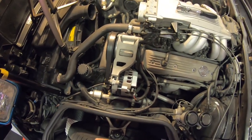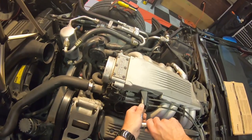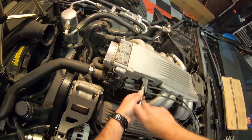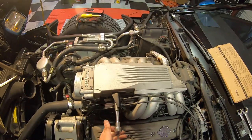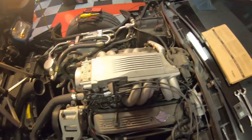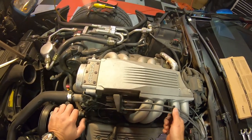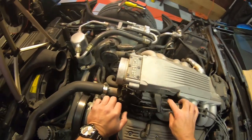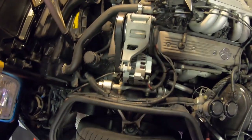And then there is a 10 millimeter socket — another bolt that you can get to with a socket — right here. So I can get my socket on there. So now we've got that free. Now this little guy just slides off — it's just on a little pin, so it just slides up like that. This is free and pretty much out of the way. You'll still be able to get your T40 Torx in here.